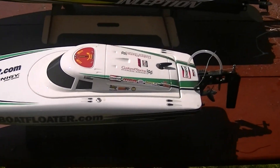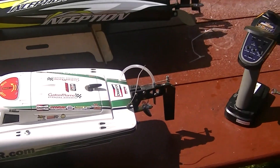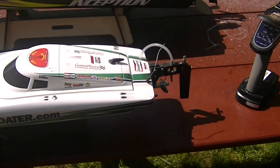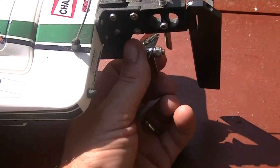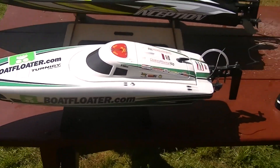This is not so much a review but a performance upgrade. I'm not really happy with the hole shot on this one — you pull the throttle and it just sits there and drags, dragging with the three-blade propeller. What I'm going to do is run a set of batteries out. I forgot my GPS at home so I'm not going to do a speed test — it'll be a runtime and a hole shot test to see what a two-blade propeller will do.